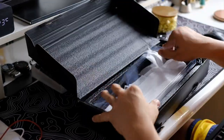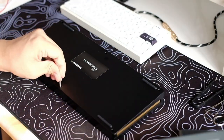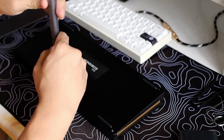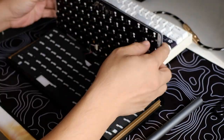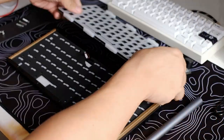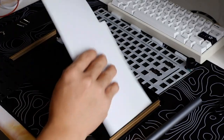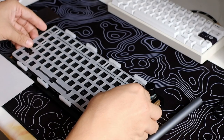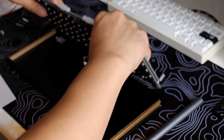It comes with some stabilizer shims, which I never use. We use a hex 2.0 screw to open up the case screws — there are two sets: shorter ones on the side nearer the user and longer ones on the far side. Remove the top case and you see the PCB plate assembly. Remove the daughterboard carefully — it's long enough not to cause problems. You then see the lower case foam and the shorting-prevention sheet. I don't use either because I use the tape mod, and with the tape mod there are no shorting problems. There's already a good amount of play with the stock gaskets, which is perfect for me.